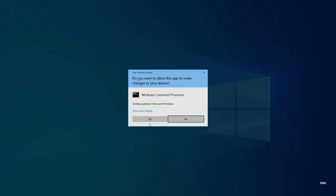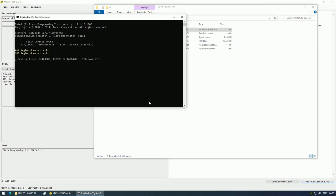Unfortunately, just like any other Chinese X99 motherboard, the smart fan function is working only for the CPU fan header and only if you're connecting 4-pin PWM fans. The other fan connectors do not have smart fan function, and if you're connecting 3-pin voltage-regulated fans these fans will be spinning at 100% speed. And of course, like many other Chinese X99/X79 motherboards, Machinist X99 MR9A does not provide accurate readings from the motherboard temperature sensors. The CPU temperature can be read correctly, but the motherboard temperature sensors do not work.